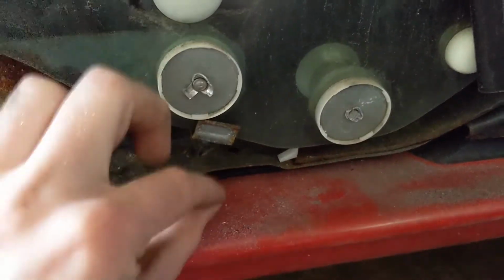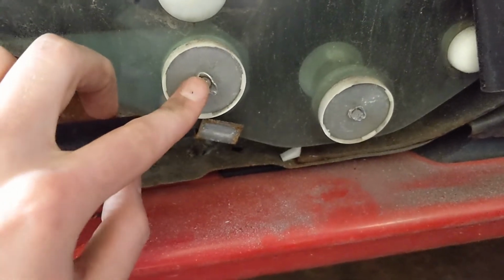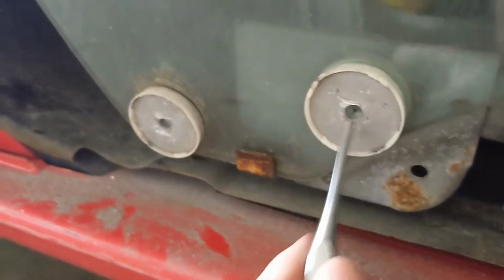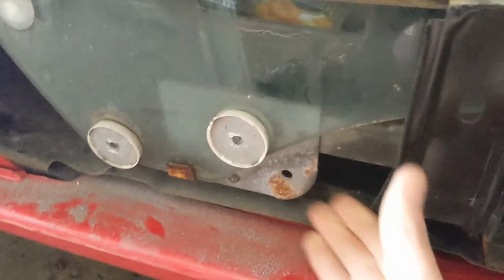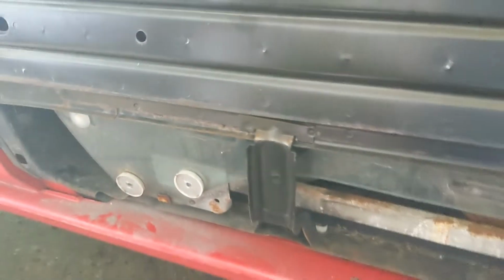So I'm cutting off that bulb and getting rid of the tabs of aluminum, and then you can get a center punch. I've already knocked these 2 out, and I've got a ball peen hammer here, very light hits, and I'm holding one hand behind everything to brace everything, because I don't want to break this glass.